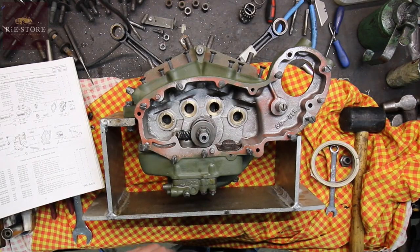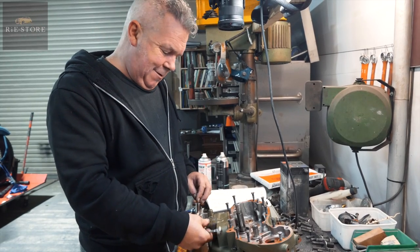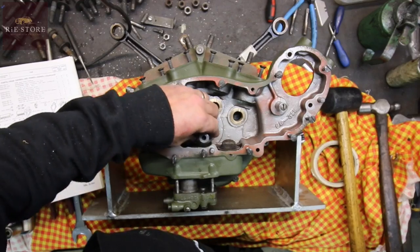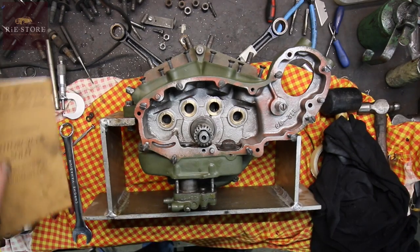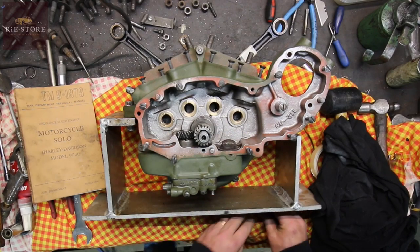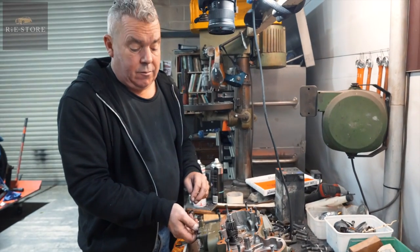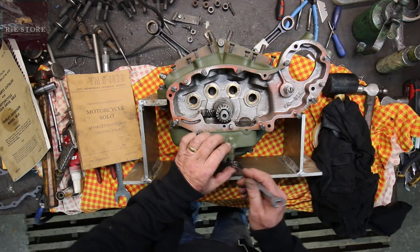That won't go past the oil pump, so you've got to take the oil pump back out. I only do it to annoy myself. It's actually been quite a while since I've rebuilt one properly, fully. Spring, spiral drive — that one goes on last. Right, that's in there. Push your oil pump back up, doesn't matter where it is at the moment. Tighten him back up. The scavenge pump gear is timed for crankcase breathing, so you have to make sure it's in the right place. Pinch him back up, making sure that's nice on the base.